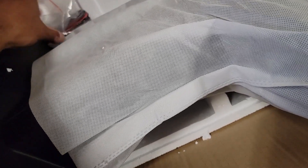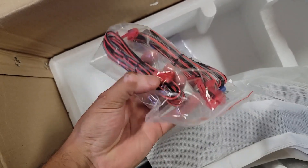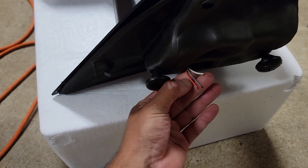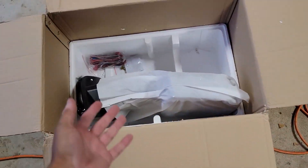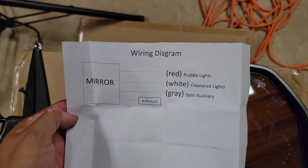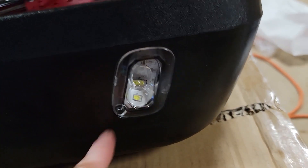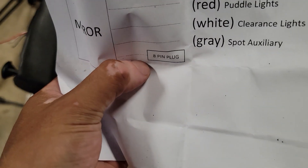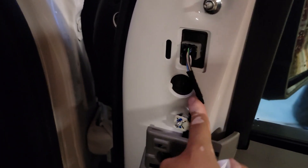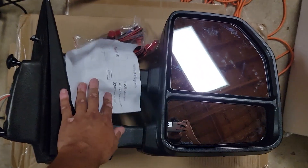We got some nuts and some quick connects — I feel like that's what we're going to need to assemble our wiring harness for the turn signal directional things. We do have instructions — a little wiring diagram. Red is our puddle LEDs, white is clearance lights, gray is spot auxiliary lights, and then we have the standard 8-pin plug which is basically this sucker right over here.